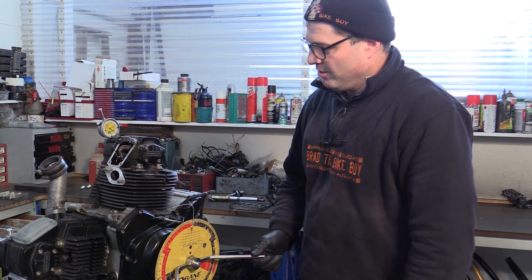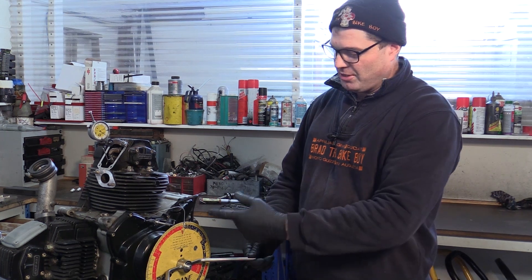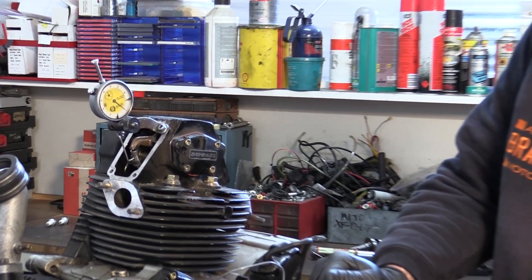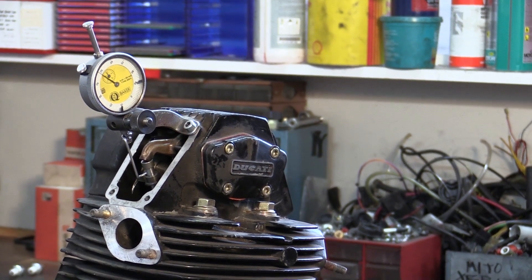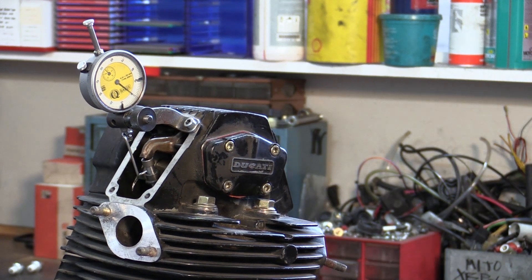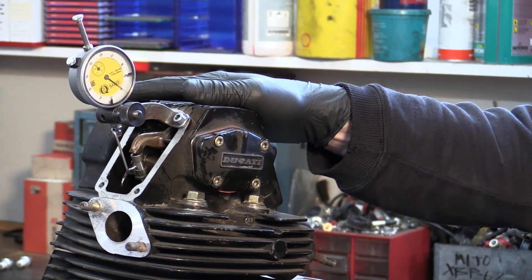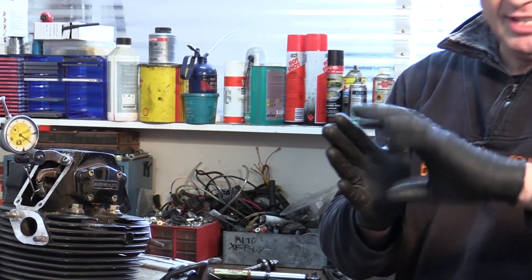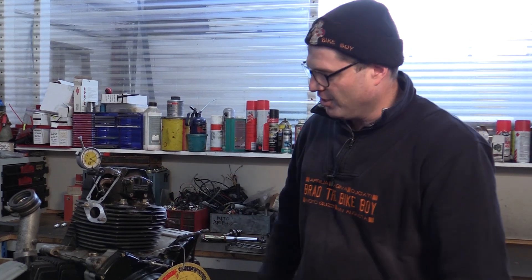Now we're going to turn it over and measure the inlet opening and closing points. The inlet's not going to open until just before top dead centre overlap — that's one full turn before we see the inlet valve open. We go all the way around, and about 90 degrees in it's going to start moving. We go around until the valve lifts one millimetre. As you can see, it's very retarded — maybe because we were rattle-gunning on the nut so long that it pulled the pulley halves. These pulleys are much like a standard pulley where the part that is keyed to the camshaft is clamped between two plates with slots, allowing it to move. It's the friction on the two plates that locates the cam — more than enough for running, but it may have moved with the rattle gun.